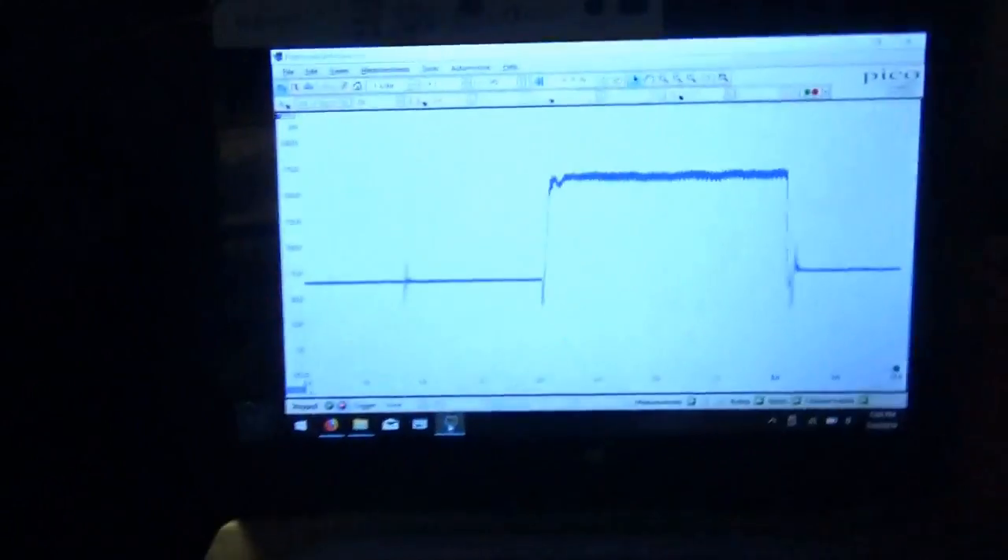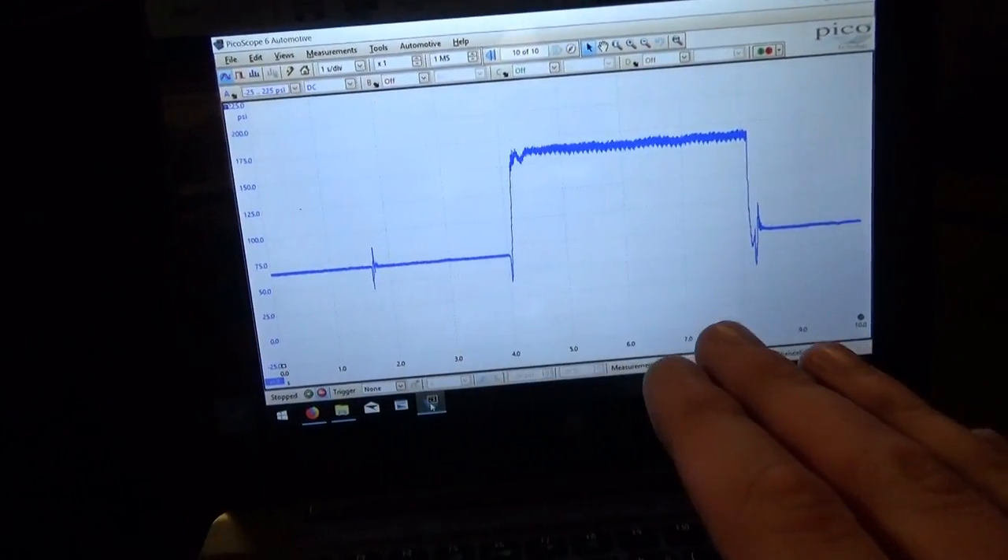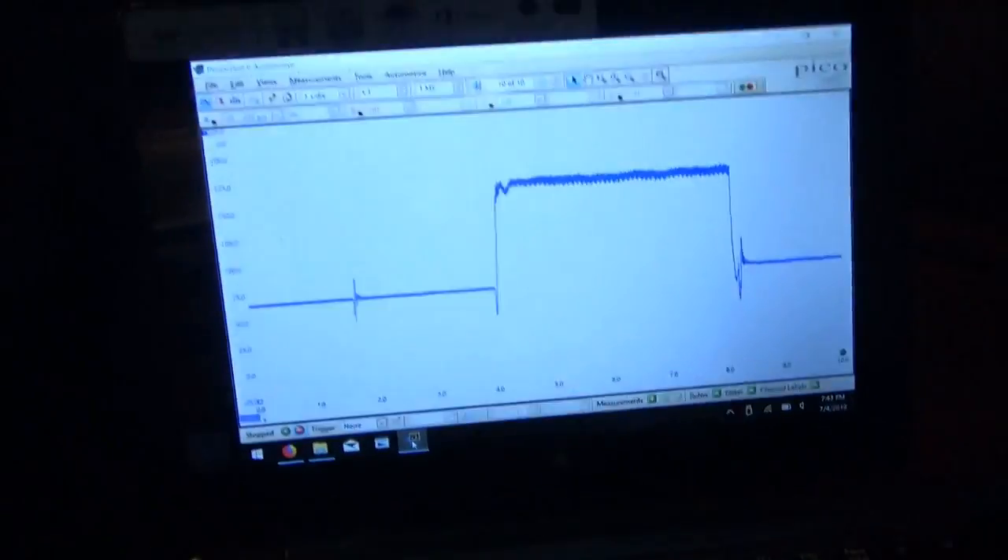So this is minimum required pressure and it looks fantastic. Now I'm wondering — to do the same check on a cold engine on a cold day, when we're not engaging, do we still have pressure? That will answer quite a few questions: it means the pump's working, the filter's fine. Maybe it's a seal problem, but we won't be able to determine that until it cools down — it won't happen right now, it's like 80 degrees out. Still, the method — I like this.